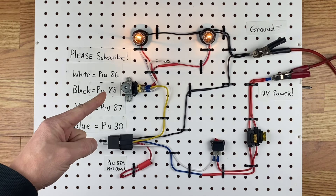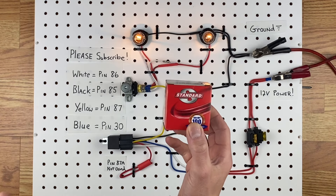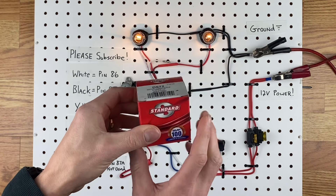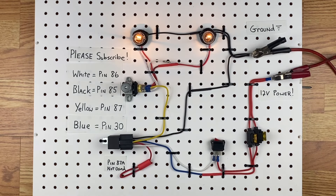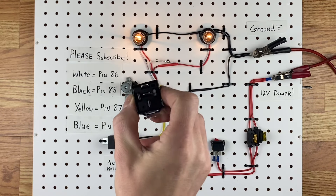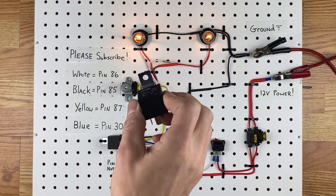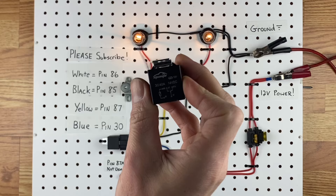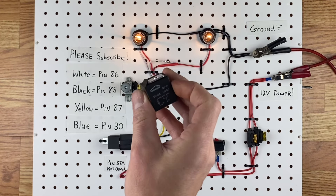This floor-mounted dimmer switch is actually out of a 1964 Chevy Impala. It's a standard part, part number DS-72, so you can grab this same exact one from any auto parts store or buy one online. The relay I'm using is a normal 5-pin relay, which is called a Bosch-style relay. They have 5 pins and are very easy to use — you can use them for a million different purposes. This one even has a diagram on the top, which is pretty great. I'll have a link in the description so you can buy these exact same kind.